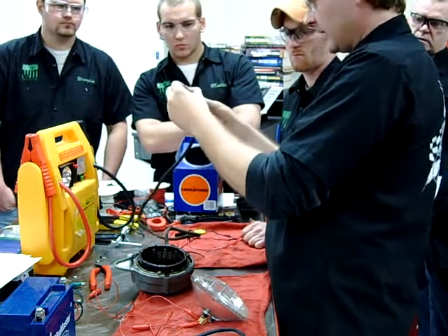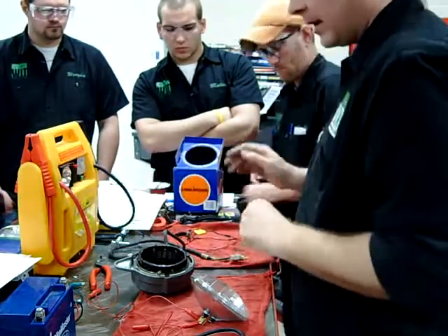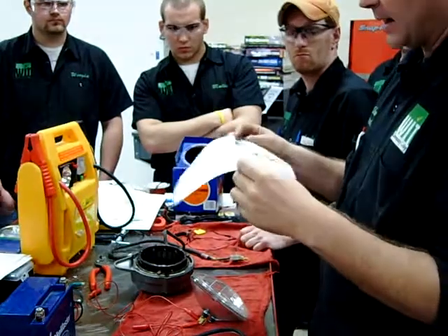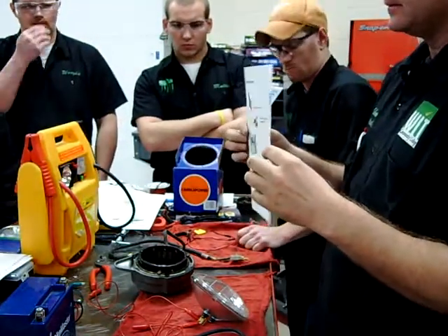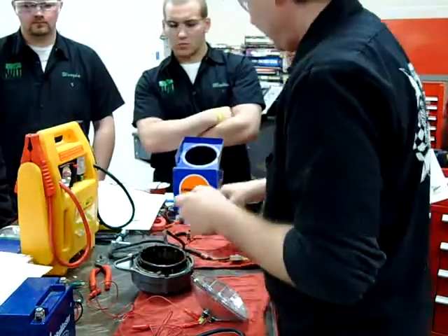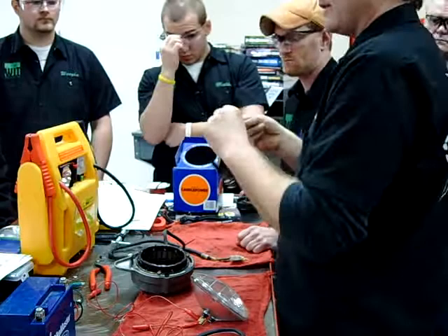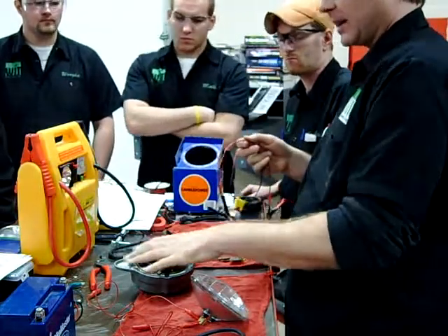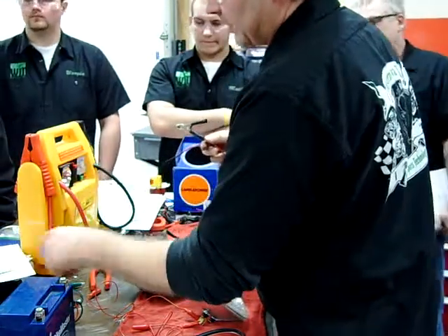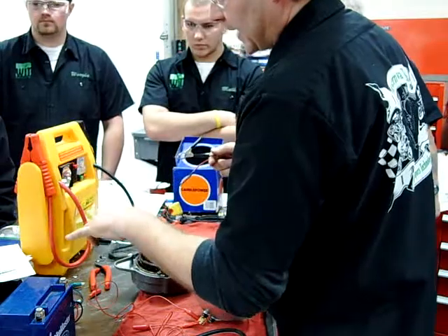That one's in pretty bad shape — I'm going to try to spread those out as much as possible. So Ryan's going to help me out here. Did you guys notice, compared to the Suzuki video, what's the one thing that I'm doing different? I heard it — a fuse! I'm fusing one of my sides in case I screw up. If we don't have a fuse on there and we screw something up, what are we going to cause? A direct short. So it doesn't matter what we do here, but I'm going to use the fuse on the hot side.